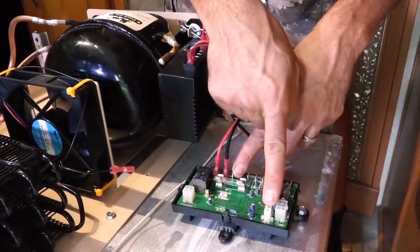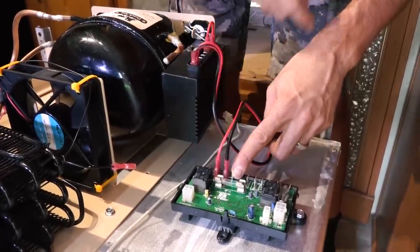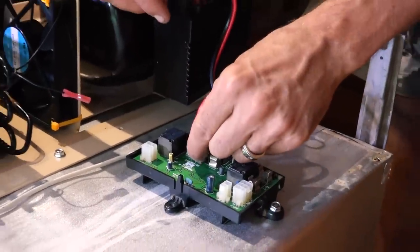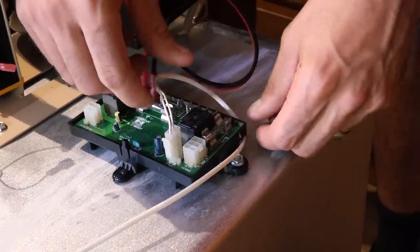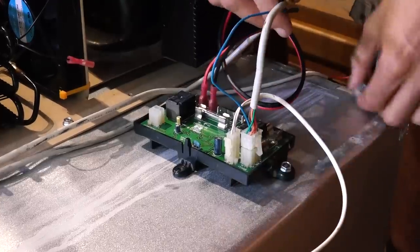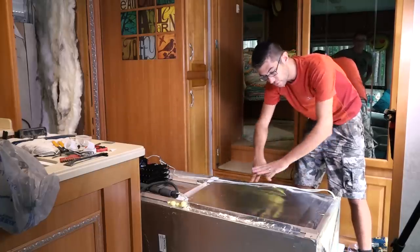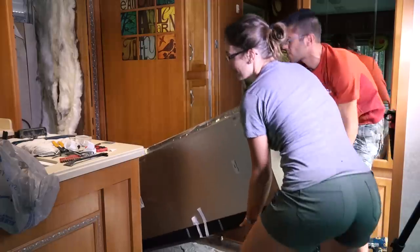When the temperature sensor detects the fridge is too warm, it triggers the relay — which used to run the AC heater — now running the compressor. We also upsize the fuse on the board from the existing 5-amp AC heater fuse to a 20-amp fuse for the new compressor, which was included in the kit. We reconnect the thermistor temperature sensor, bring the control wire back down from the display panel on top, and reconnect the heating element for the top climate control. We then tilt the fridge back upright relatively quickly before the foam fully sets so we can get the freezer screws in.